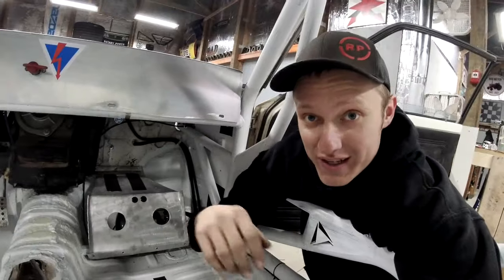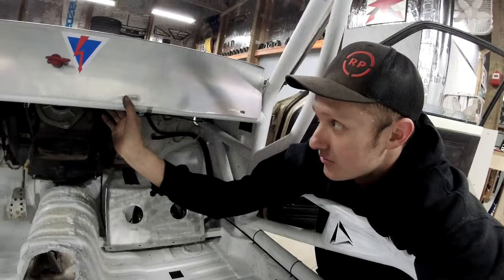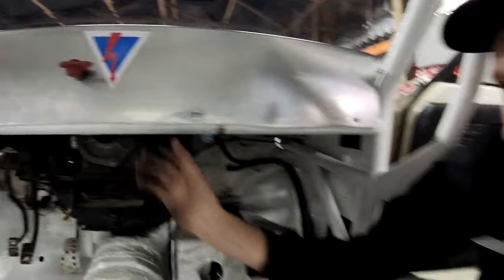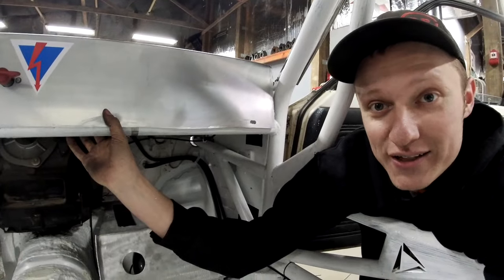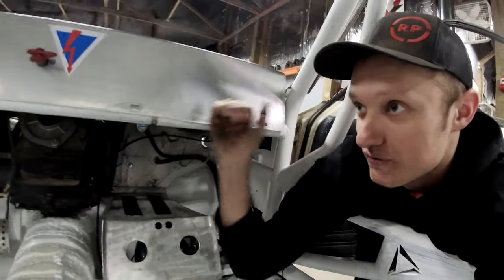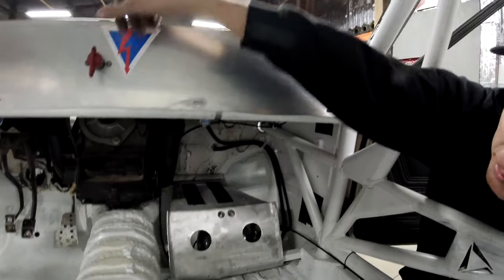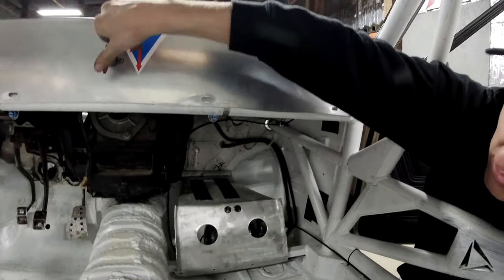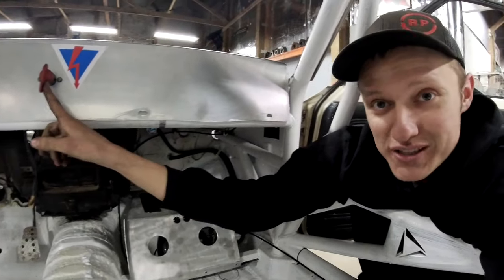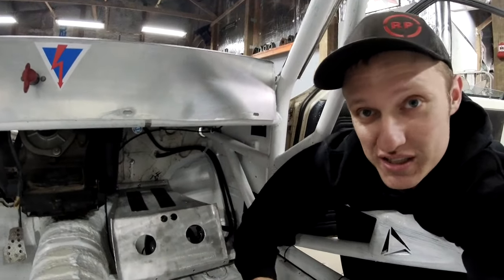It's flat pouring outside. So the dash mounts to the top. At the bottom of this, I've put these slots in here and I'm gonna hose clamp the dash to the dash bar. With big worm gear hose clamps, it's gonna be four of them. And this thing is not gonna go anywhere. In addition, I've mounted my main power kill switch up here in the dash. Calvin and I can reach this, just barely. We can reach it when we're fully cinched, strapped in.